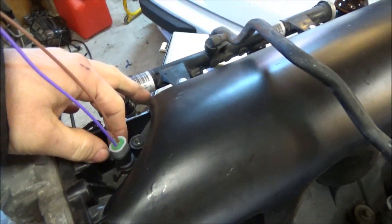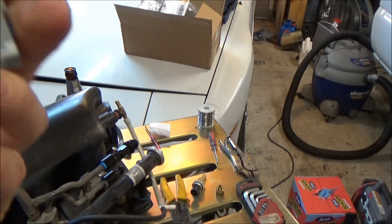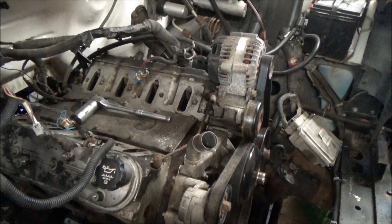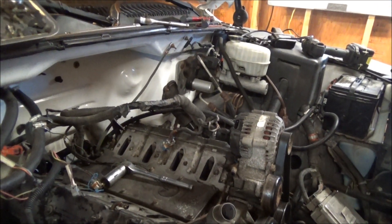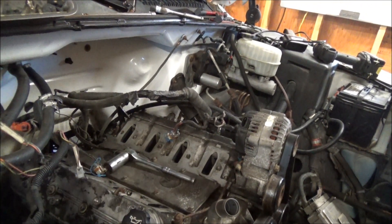Also the intake air temperature sensor, which we've gone ahead and stuck in here — I got the pigtail for it on eBay. The pigtail will be labeled with an A and a B to let you know which wire is which. Then we need to figure out which of the two wires in the old mass airflow meter's five-wire setup are for those, and basically cut them and solder them onto the pigtail.